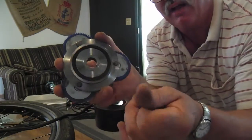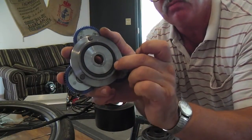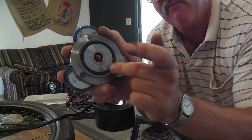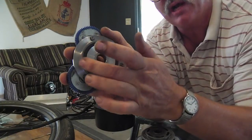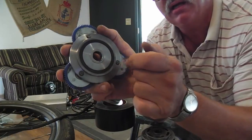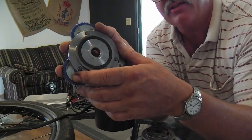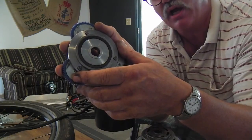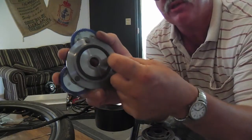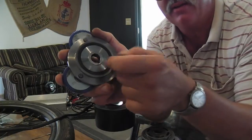And it's a clever design, but the caging material is plastic. And when these start getting brittle and have breaks in them, that's what I found. It was just some breaks in this little top seal on top here. It causes those little cogs to not give the gripping action, the cogging action that they once did. So I just ripped it out, dug it out, and discovered that this is the weak link.